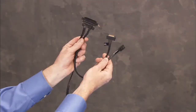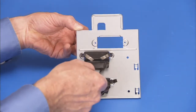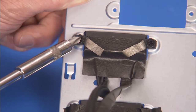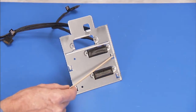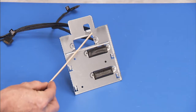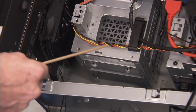To replace a hard drive SATA cable, align the cable back onto the bracket and secure with its two Phillips number 2 screws. There are four tabs on each bracket for the hard drive SATA cables that slide into four slots on the hard drive cages. There is also a tab on the rear end of the bracket that slides into a slot on the hard drive cage.